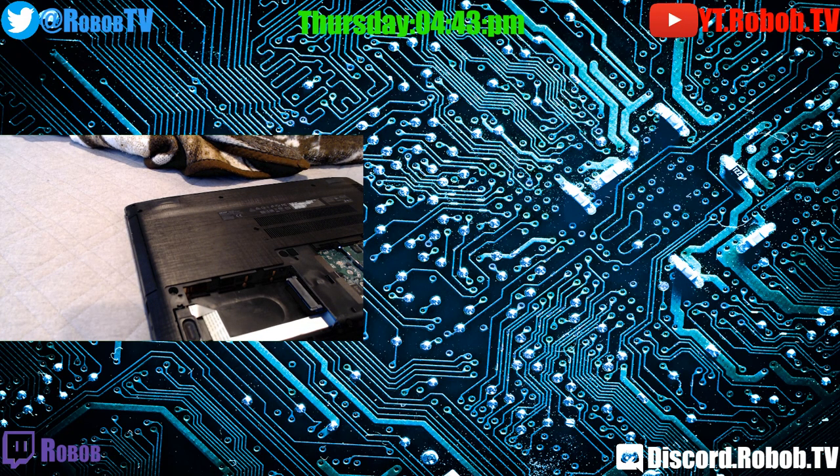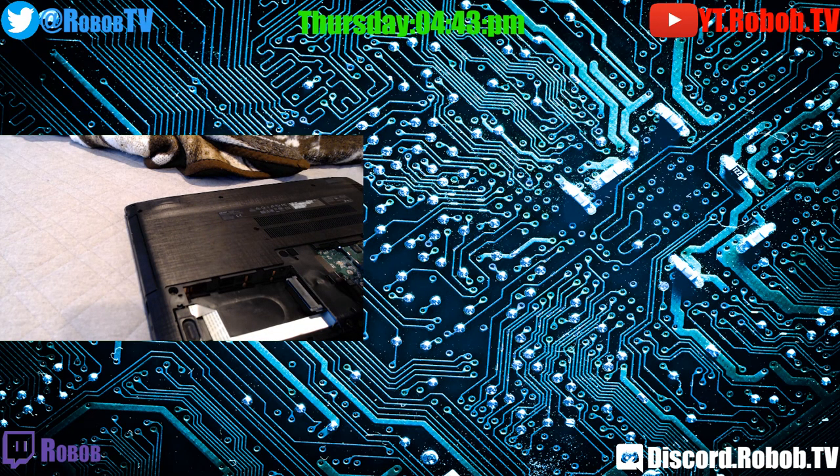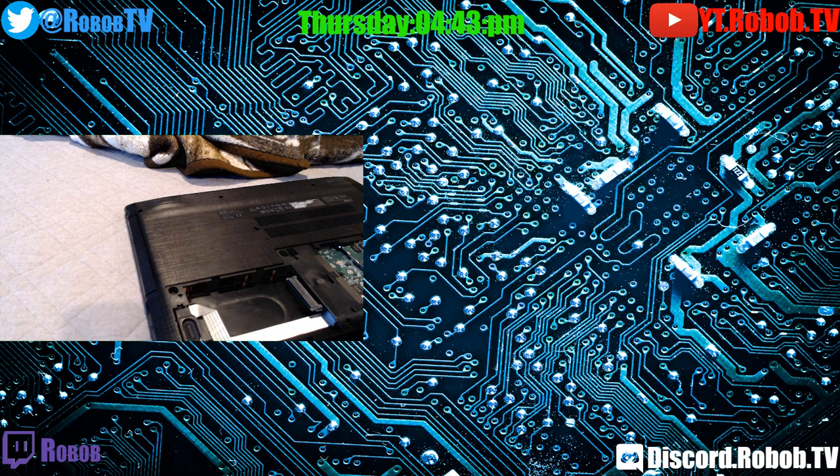So I'm going to remove — there's a little bracket on here that they put just to act as a bumper basically to keep it in the bay. I'm going to remove that and we're going to transfer it over to the Samsung 860 EVO. You just got to pay attention to where these little tabs are. There's a fatter end towards the plugs — you just want to make sure that goes towards the plugs on the SSD.